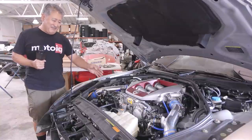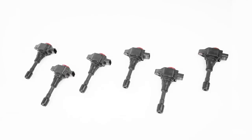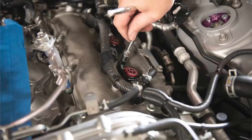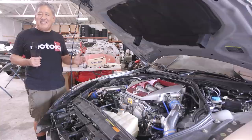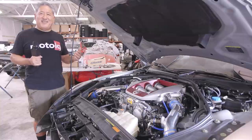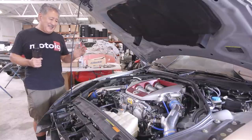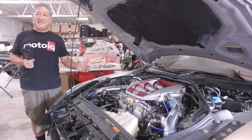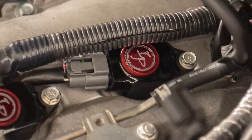To improve the ignition system, we have Ignition Project multi-spark coils. These coils have more energy and a stronger spark, but they also fire the spark multiple times — about ten times every ignition cycle. Your factory coil only fires once, so you only have one chance to ignite the mixture and more chances for a misfire. The Ignition Project coils not only have more spark energy but re-strike the spark ten times, making it almost impossible to misfire. It just bolts right on and replaces your stock coil pack. I've had a lot of success running these in time attack and drift cars — it's one of the best things you can do to upgrade your ignition for the money.